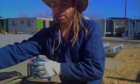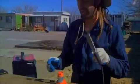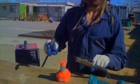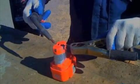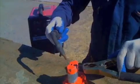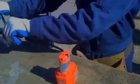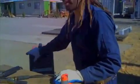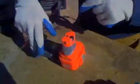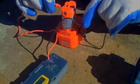And what I'm going to do is now flip the battery and zap it correctly. So now we're going to put the correct positive terminal — which is my ground clip — on the battery's positive, and the welder negative on the negative battery terminal, and give it a couple of zaps and see if it starts rising. This took forever to figure out. And we'll see what our voltage is now — it should be a little bit higher. We had 7.37 last time, and now what I'm getting is 10.5. Great.